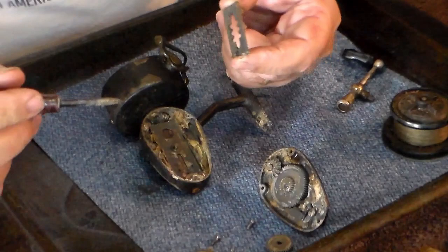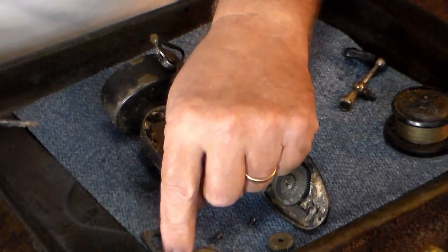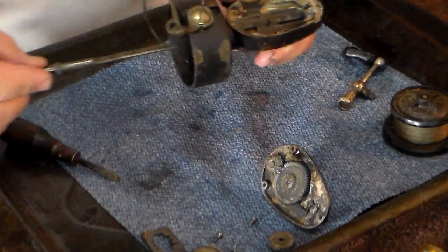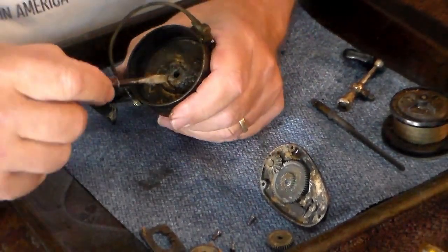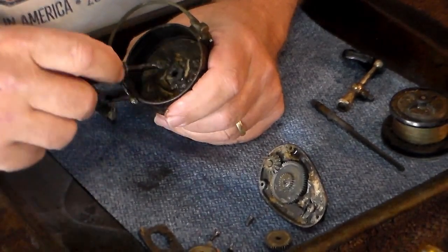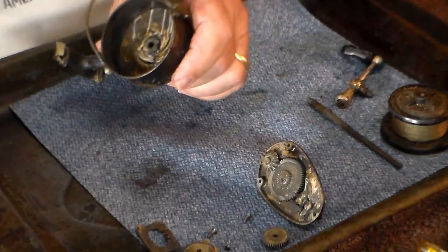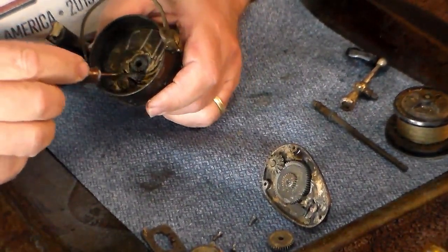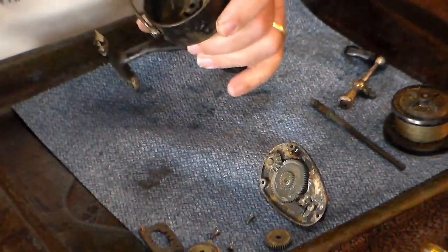We've removed the oscillating gear - this is the one with the three teeth on the side. That's your oscillating gear. This is your oscillating plate, and we've pulled it out. See this pin? This pin fits into a hole in the axle shaft. With those removed, there should be nothing holding the axle shaft in, so we can pull that out. And it appears that someone has straightened up the ramp on this - so that's probably what we're hearing with the tick, tick, tick inside here.